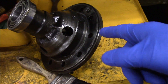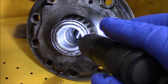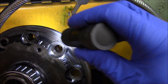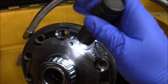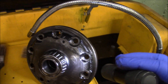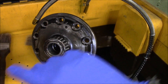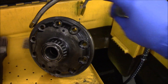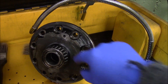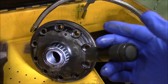Things aren't really adding up here. This is the old diff. If you look inside, you can see some kind of block apparatus, and through the other side you can see two sets of splines and the recessed nature of these bolt holes. This rough cast and machined housing — I think this is actually a limited slip, so I pulled out a limited slip to put in a limited slip. One way to test: you turn one wheel, and if the other wheel goes in the opposite direction it's an open diff; if it goes in the same direction, it's a limited slip. This one was testing like an open diff, which tells me it's worn out. The oil coming out of this kind of stinks like clutches — so it's not a limited slip differential, it's a slip differential.